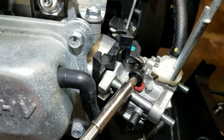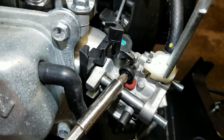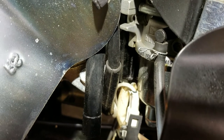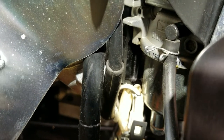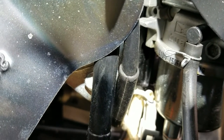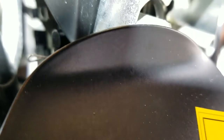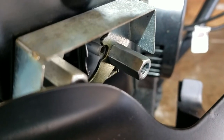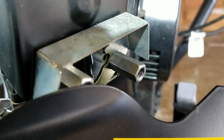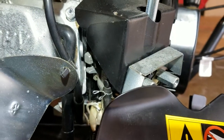So this black screw that I'm about to undo, I have to keep accurate count of how much I turn it, so I don't screw up later when I put it back in. I found out that there was also a little leak or seepage between the carb and the engine block. That's probably one thing that was causing it to surge. And then this nut here was also kind of loose. So I tightened it up more than what it was, and tested it a little bit. It seemed to be running much more smoothly.